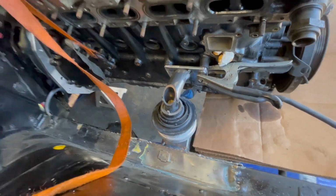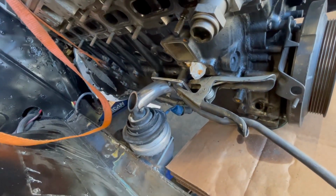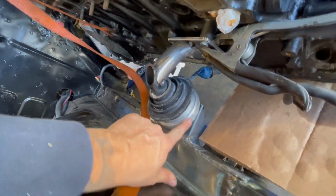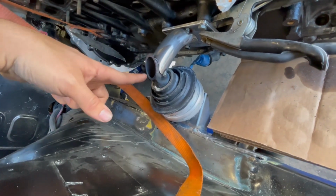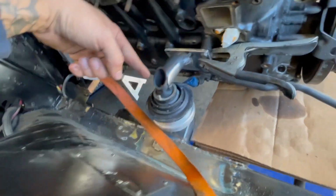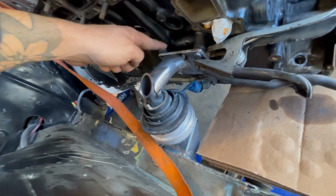So here it is. This is going over to the TIG station. It's going to be welded together. So here's the part we made yesterday, the bottom pedestal. Stock Mercedes. This is the rod end thing that was lathed. This is cut at an angle so sockets can't get stuck in there. Here's our bend we just made and the plate we made yesterday.